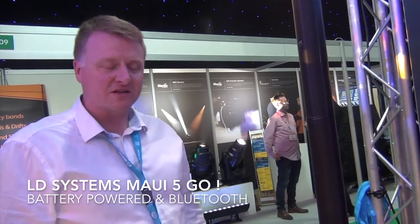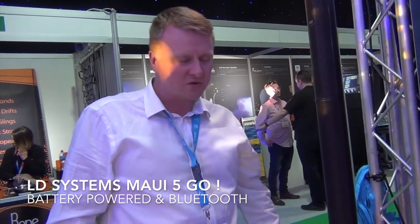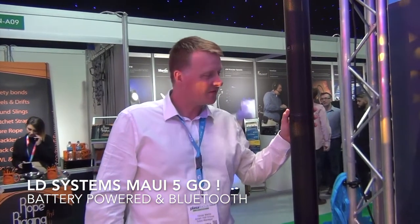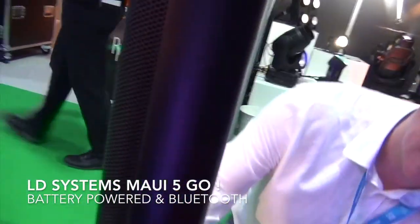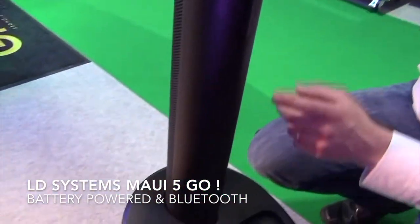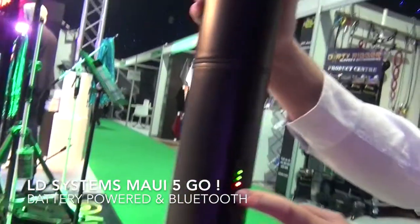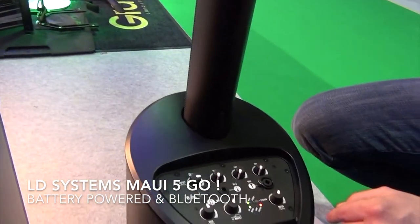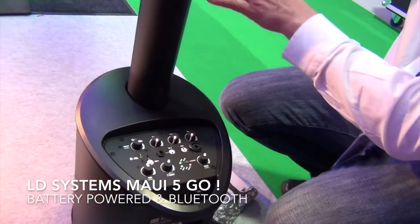The battery is an LG high-capacity lithium battery. It can last up to 30 hours on one charge. To charge it, it's two hours to reach 80% and three hours to reach 100% — though most people won't let it go entirely flat so it'll typically take a couple of hours. It's 200 watts RMS and 128 dB. You can also plug it in and run it from the mains, and it will trickle charge the battery at the same time.